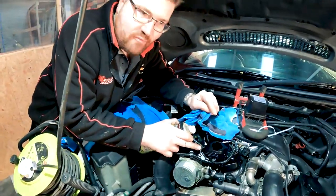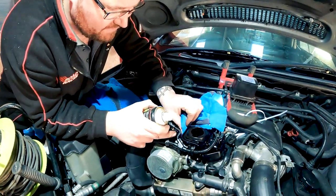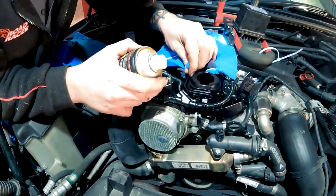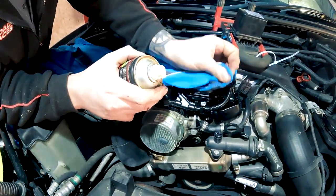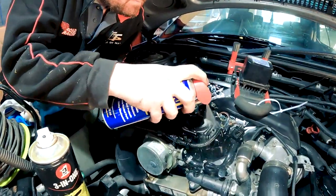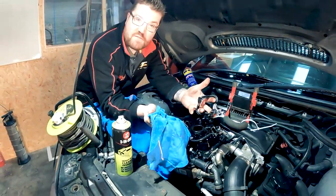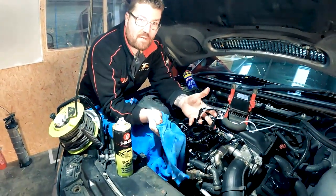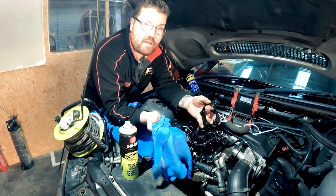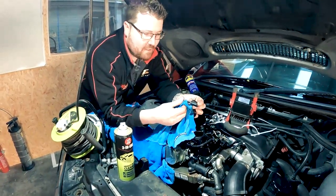It would be fairly usual to have a buildup of oil around the oil filler from years of putting oil in and out, but I just think it's a little bit too high. So maybe if I clean all this out and tighten the tabs down on the oil filler cap, it might just do the job. Guys, if any of you have had this problem in the past, please feel free to comment below because I don't know where this oil is coming from. But this looks like the culprit - we'll find out soon.